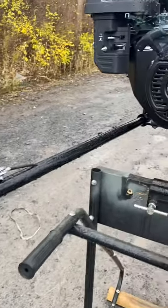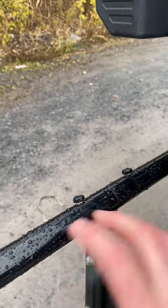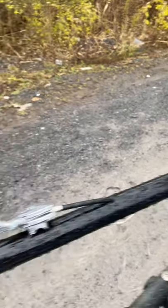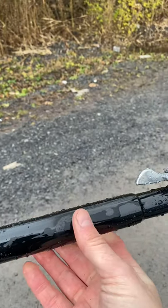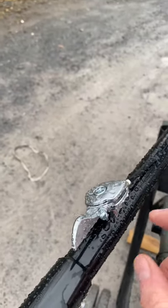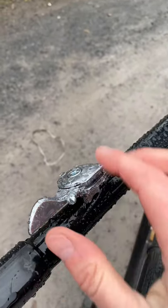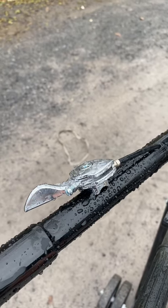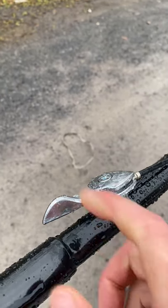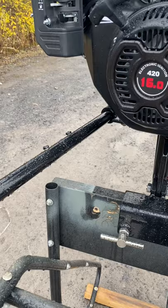The SD300 has a straight two-piece tiller handle — the two-piece connection allows it to ship in one box. The handle is a little wider down here with a grip, but there's no rubberized coating; it's bare steel. One notable feature is a small thumb throttle control with no spring return — you have to manually accelerate and decelerate, and if you let off the throttle the engine will not return to idle. Also notable is that the SD300 does not have a kill switch installed, but we do send a kill switch with every kit.